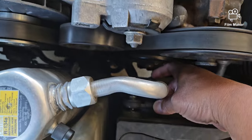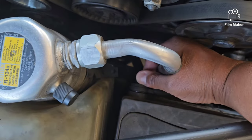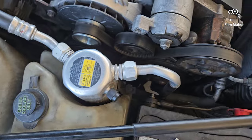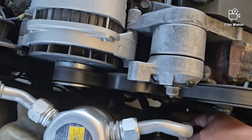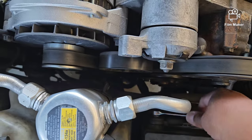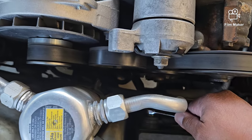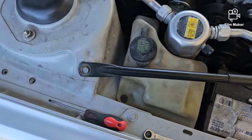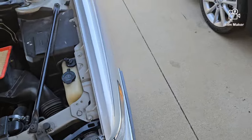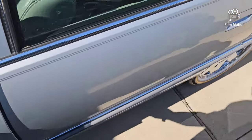I'm going to put the PCV hose back on — that hooks up into the throttle body then goes into the PCV valve assembly. Then I'll put the negative cable back on the battery so we know we got power. Let's go to the car and make sure it works — I should hear something, I want to make sure this thing retracts back and forth. If it doesn't do that, then it's no good.